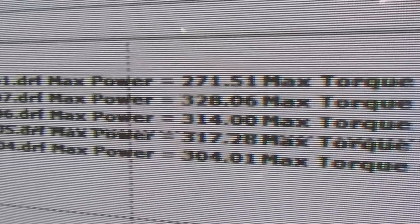It's just a very simple matter of running more boost than the plugs are set for. Don't be blowing the gap now — that's all, we just got to drop the gap.